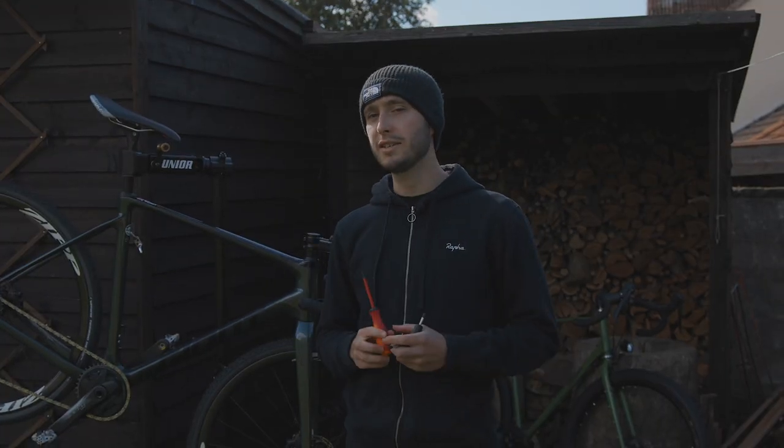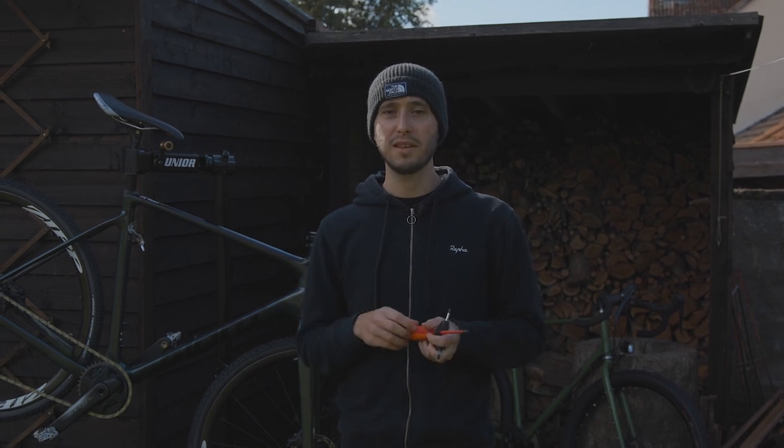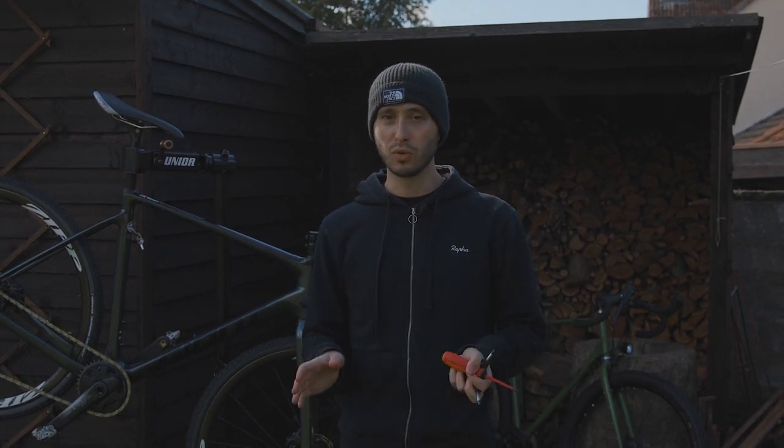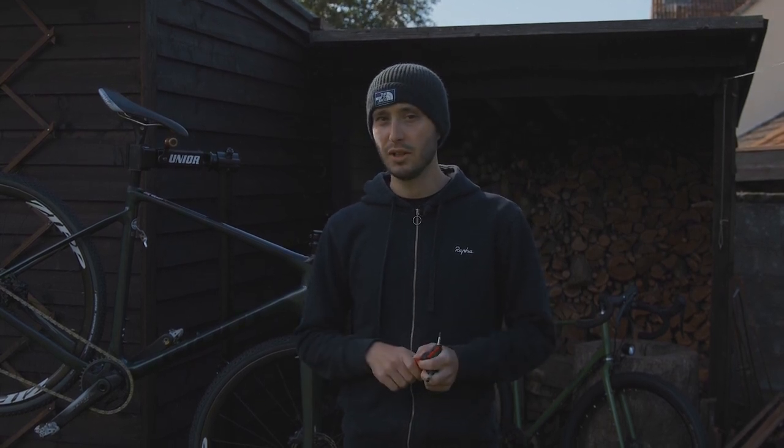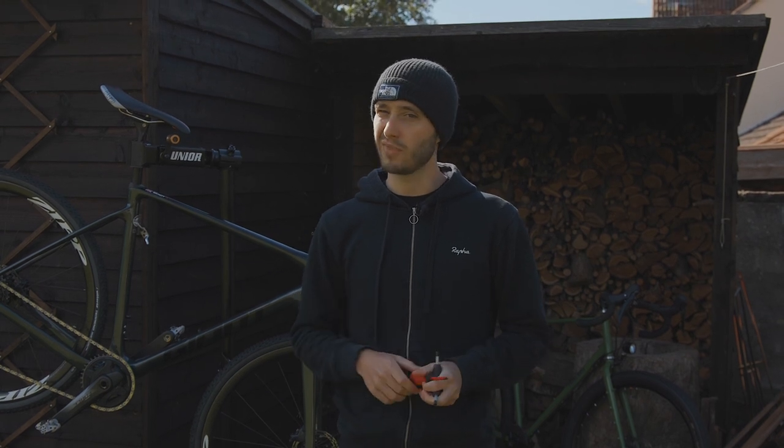The conditions you're riding in can influence this too. In very muddy conditions with few roots and rocks, I'll drop that pressure by around 5 psi to about 19 psi. If riding in quite rough or dry conditions I'd want to protect the rims from impact, so I'd add about 5 psi to the original value, taking it up to about 29 psi — that's my range. You can also add a little to the rear to compensate for the added load it bears. And note: if using tubular or tubeless it's fine to occasionally feel the wheel rim contacting the ground, but for clinchers I wouldn't want that.